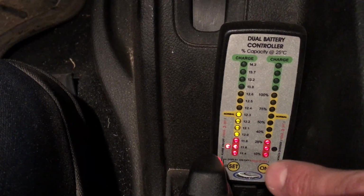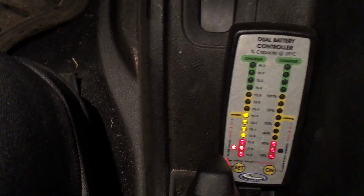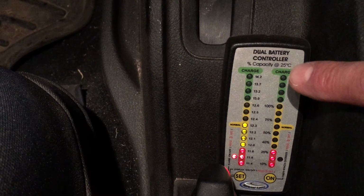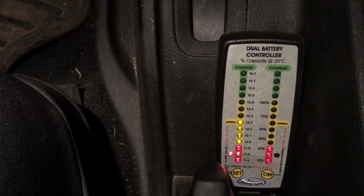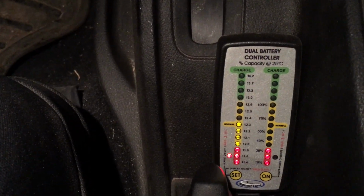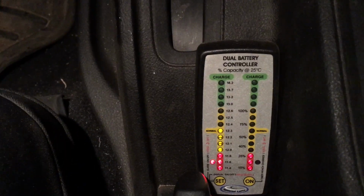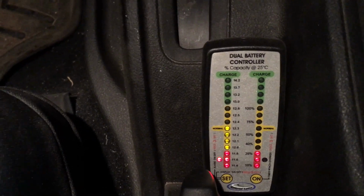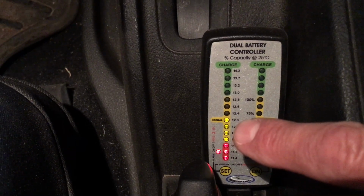So what we expect to happen, and will happen, is that the DC charger, shore power charger, is going to go and do its job and bring this up to full power. That would be 13.1 volts resting. The Optima red top can't go as high. It goes to 12.75 because it's a traditional battery, and that's why it works better for a start battery than the Optimas, the yellow tops and the blue tops would do, or Odysseys of similar chemistry. And it is currently sitting at 12.3 volts.